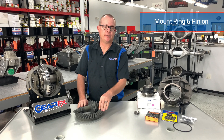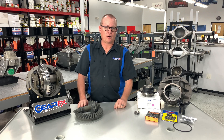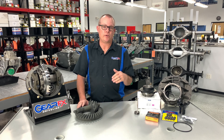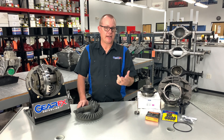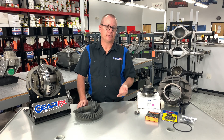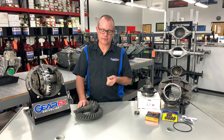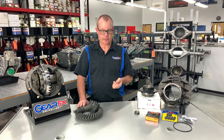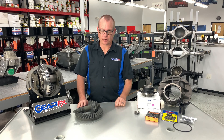The next part of the build is mounting the ring and pinion onto the Eaton True Track. We use ARP hardware. Once it's torqued up properly, the unit is installed in the rear gear. We measure runout of the ring gear, hop of the ring gear, and backlash, including the variance of backlash. Runout or hop can create noise in the ring and pinion. When you're building a rear gear for Talladega Superspeedway and going 200 miles an hour, those are all very critical things. We feel it's an important build procedure that adds to the quality of our components.